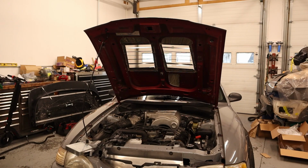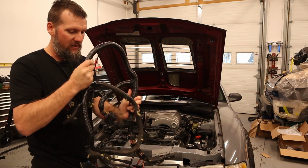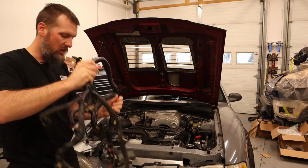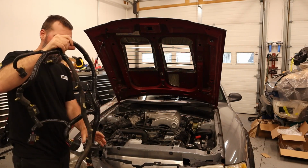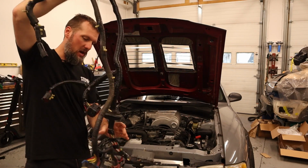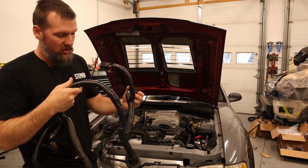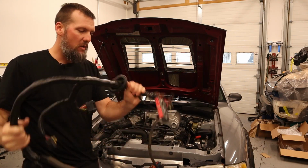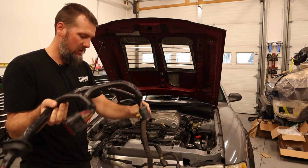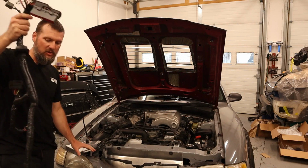And then the fender harness, the one that's in the fender that goes from the ECU up, started as the base V6 one that actually came from this car. I used it because I know it fits into the car. All the other plug wires will reach and are the right lengths and right genders for power and everything there. But I did have to modify it since it was a V6 to add in the two extra injectors and then all the wiring for the coils. But it was already the EEC-V connector, which made that nice. And it's all the right lengths and everything like that. So just adding wires to it, moving wires around to work with the Crown Vic ECU.